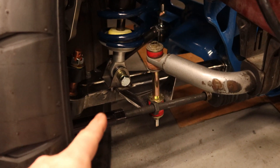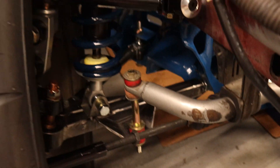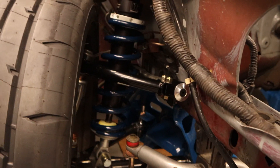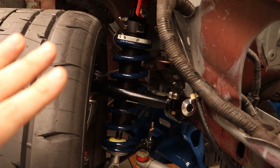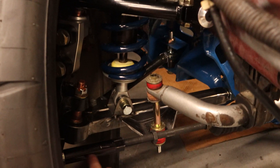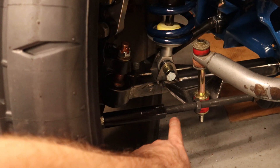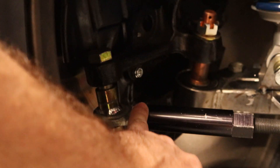You can also see that I have the sway bar mount on here — it's not actually tacked on or anything, but it is placed and configured. That should work out perfectly. The suspension is pretty much all done now. I still need to get a longer tie rod — I found a company that makes some that are M14 on one side to 5/8 on the other, because I have the bump steer kit from Maximum Motorsports that uses a 5/8 bolt and a 5/8 rod end.